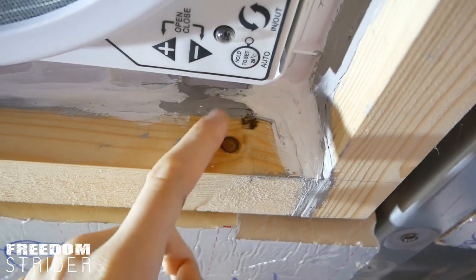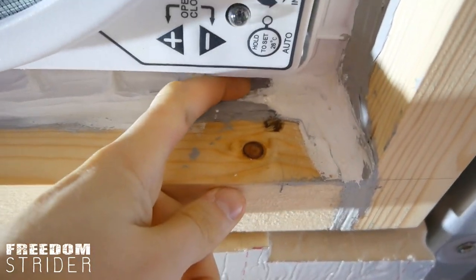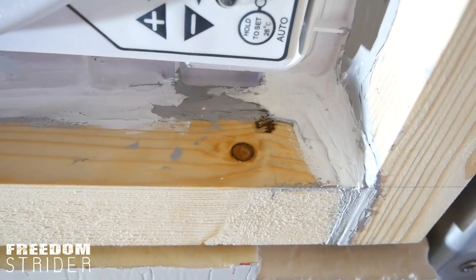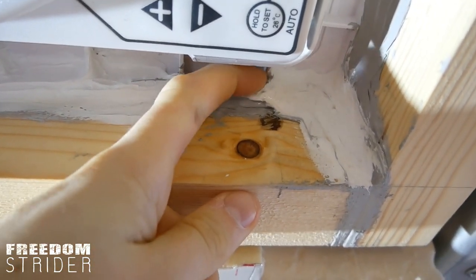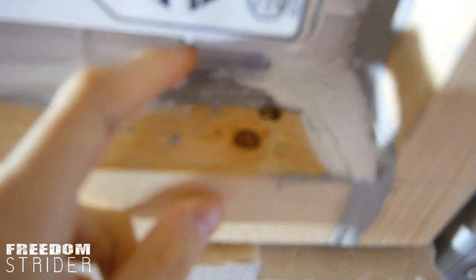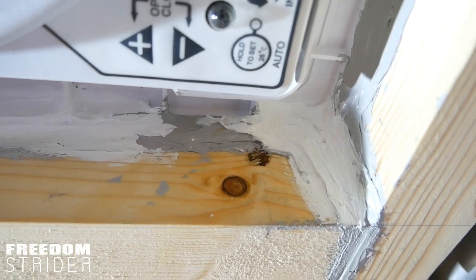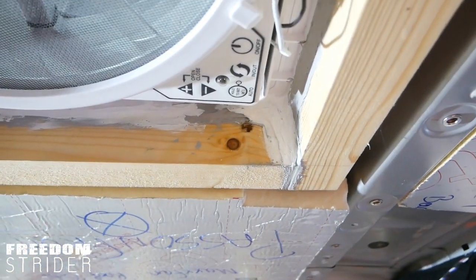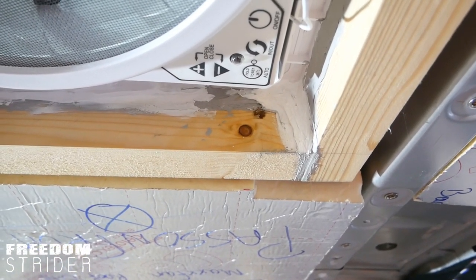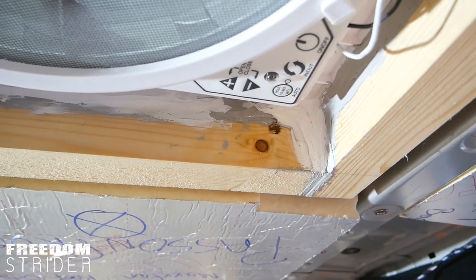Well, we've left it for five minutes. This is definitely damp wood now all the way down to here. So I lift that up — yeah, more water's coming. Is it dripping? No, but more water is coming out. I feel it with my finger — it's not dripping though. But you can see it's definitely damp in there now. It's making its way down obviously. But that doesn't help us identify exactly which hole. It does not — because it takes too long. But you can see the discoloration in the wood. That area of wood is damp, but the rest, even though we sprayed all around the frame, the rest of the sealant and the wood is perfectly dry. Just up there is the problem.